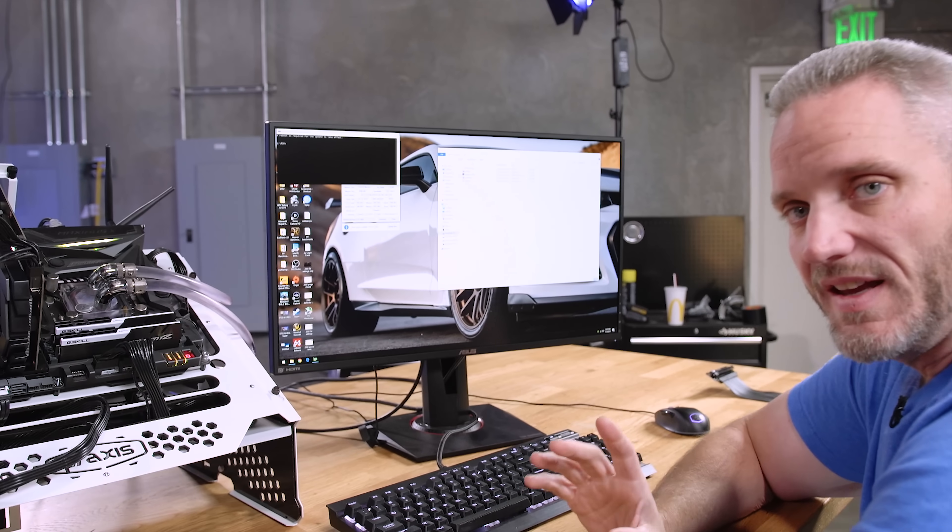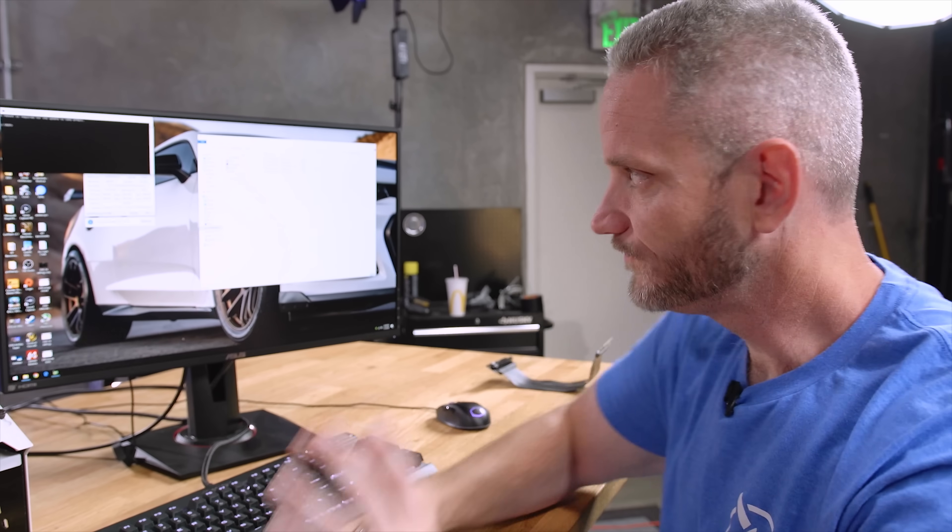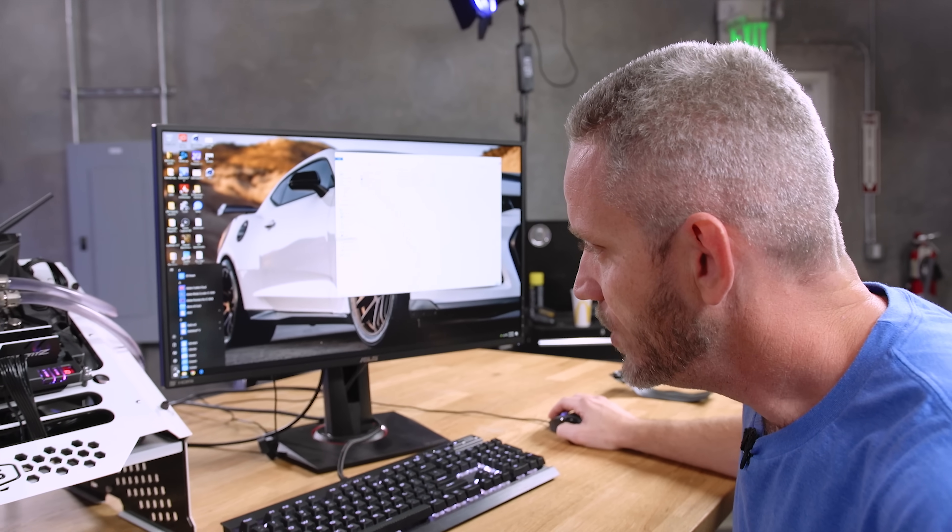That's actually somewhat normal, because the thing is it's running still off of the previous loaded BIOS until you restart. So when I actually flashed the wrong BIOS on my previous graphics card, I was like, yeah it worked. And then I restarted the computer and it never came back. In fact, it was so broken that the graphics card itself was not even identifiable to the system. We tried everything we possibly could to get that EEPROM to rewrite, but it was so broken that even when we would identify the graphics card, it just said VGA - and still gave you no picture whatsoever. What we did was the old trick of having two graphics cards in the system at the same time, booting off the good one, and then NVFlash to the second card, because you can tell which card you want to flash to. We showed how to do all that when we did our Titan RTX BIOS upgrades. Let me shut this down.